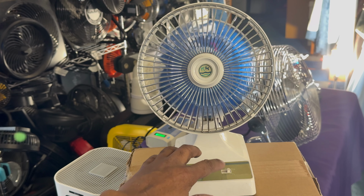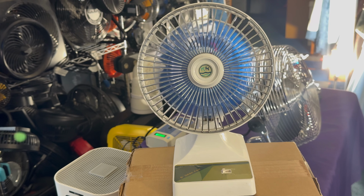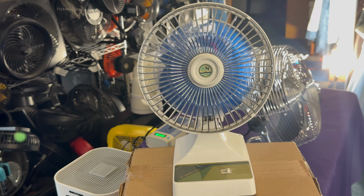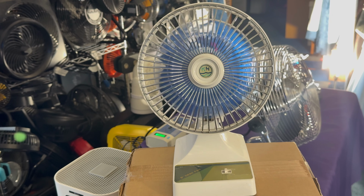So it's running on low. The aesthetics look good. That always looks good, but don't let that deceive you. The most important part is the motor. Can't really hear it all that bad on low. But even on low, this thing moves a substantial amount of air really good. Run it back to full power. Got the washers going crazy. And spin it down. Spin down time is decent, so it's definitely not the bearings. It would have to be the washers.